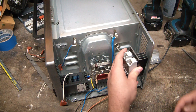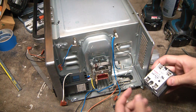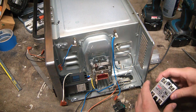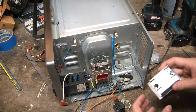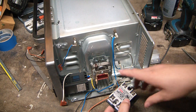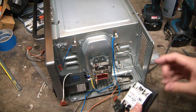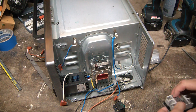I took a look through my heat sink scrap bin. I was originally planning on going with this one since it's a nice fit, but because of the way it's stamped and the small surface area, I think this other one might be better — I could mount it vertically, have it poke out the side out of the stamped area, and I'd have better access to the terminals as well. So I'll mark this out, get a couple screws on here, mount the SSR, cut a hole in the back, and we'll be good.